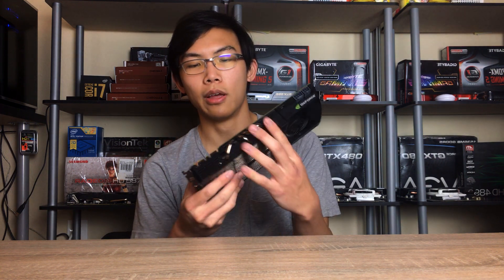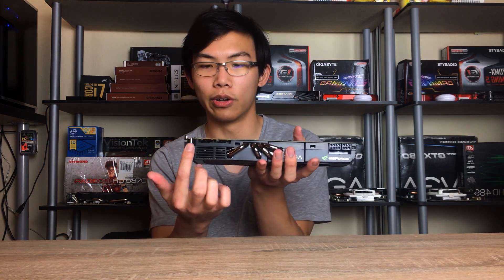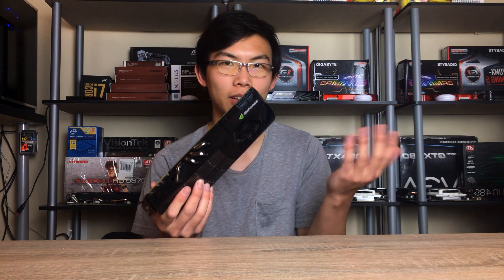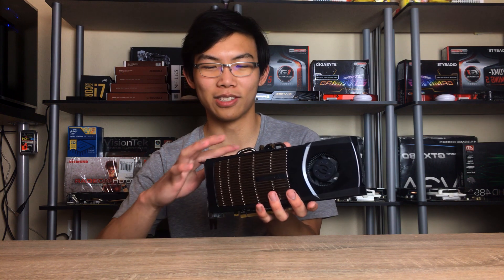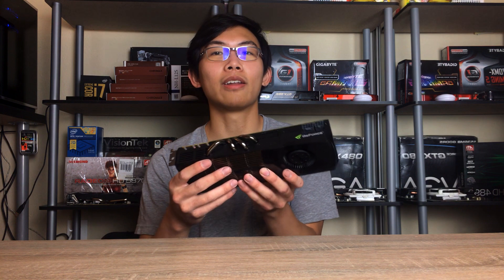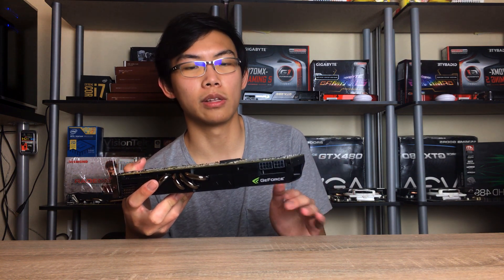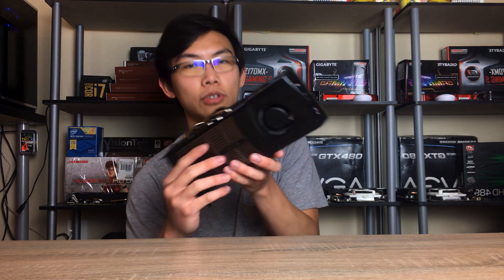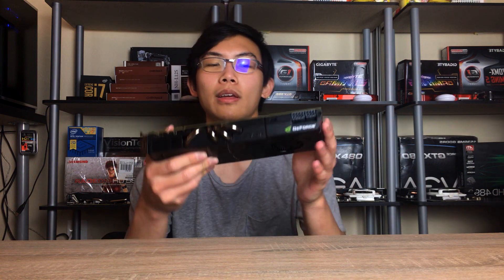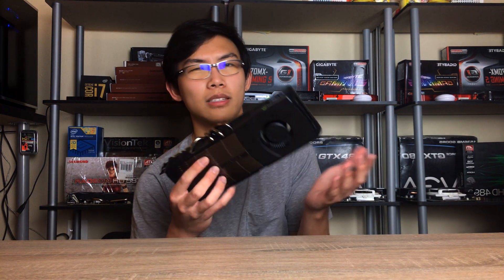SLI used to be a very huge thing. This card does have SLI fingers up top, although the placement kind of confuses me a little bit, because this is right over the vents for hot air over here. So if you put GTX 480s in SLI — which is a terrible idea because you'll basically melt down your whole house — it'll get even hotter, because the SLI bridges will close up the vents. There's also a rubber strip on here, meant for SLI setups to space out the cards so they don't sag down and cover up the fan holes completely. This was back when SLI was still a thing NVIDIA was pursuing, instead of these days where no one is really pursuing multi-GPU technologies — AMD dropping Crossfire support completely on their new cards, and NVIDIA only supporting two-way SLI, and even that's iffy support at best.